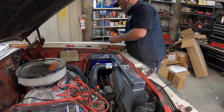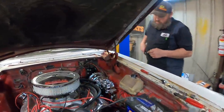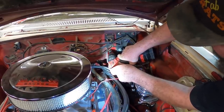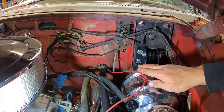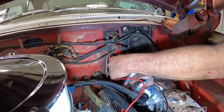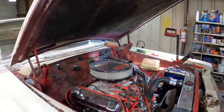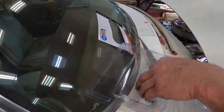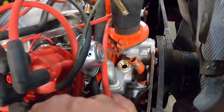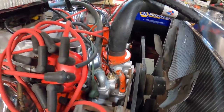She's going to fit. Make the fitting — that's going to be that one. Now let's make a hole. Maybe that'll be big enough for it, just like that. That should give us enough to get down there now, enough to stick all the wiring through it and not cut it — because the oil hose is over there. This little white guy — you don't want to split that one or you get an oil bath. It's going in. Perfect — that should just seal it.